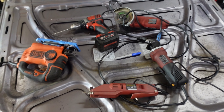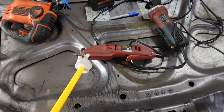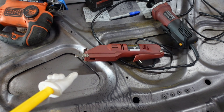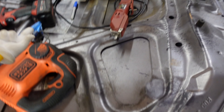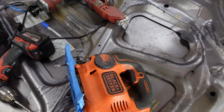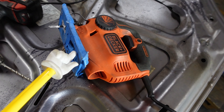I like to have options — just whatever you have, whatever's easier for you. A jigsaw is probably one of the easier tools to have, though mine is a bit janky and I just need a new blade. Normally I'll drill a big hole in the middle of the panel, then start making my cut around. Jigsaws are good for long straight cuts, but once you get into tight corners and circles, they're not very handy. That's where other tools come in handy. I also recommend taping off the base plate if you're using a jigsaw, because it will vibrate against the panel and scrape up your paint. Not that I care about this paint — so let's just cut stuff up.